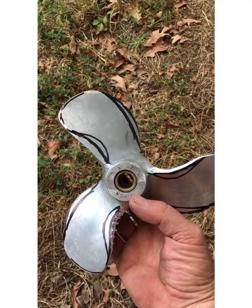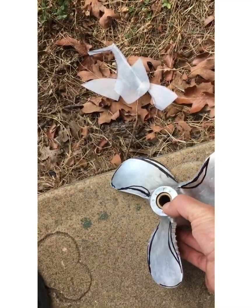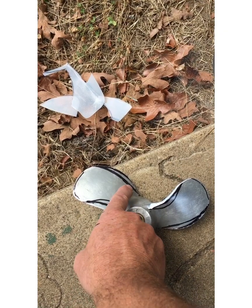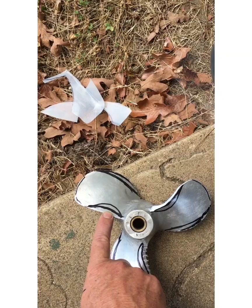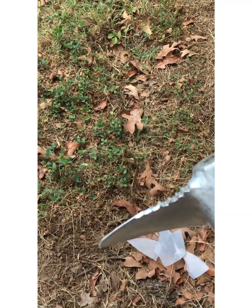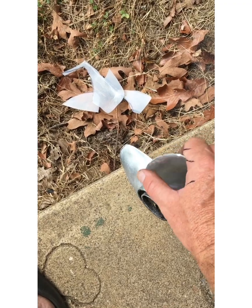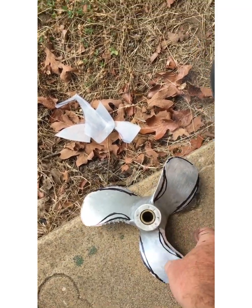The boat went seven miles an hour but the pitch on the prop is probably too much. I watched a bunch of videos, made a template, and marked where I think it should be cut — then to play it safe I made a line at half that amount. I've already cut all the leading edges halfway and I'm working on the remaining blade. Since there's too much pitch, removing material will relieve that last lip. I'll smooth the front edge to the right thickness to give it a little less pitch, and then we'll see — the motor was probably only turning about half the RPM it could.